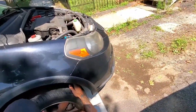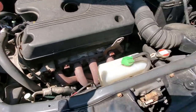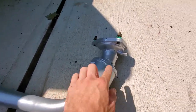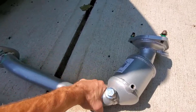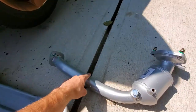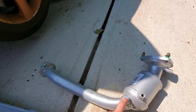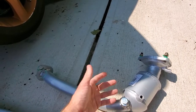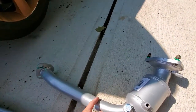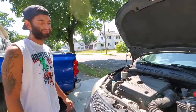Julian's looking for the connector. On the cat they actually have a plug here, a plug here, and a plug on this side. For the Suzuki SX4, the second O2 sensor actually plugs into this one. I was under the impression it plugged into the other because on some videos I'd seen it screwed in there. I was losing my mind, and Julian comes under the car for two minutes and found it — it's running on the back side towards the middle of the motor.